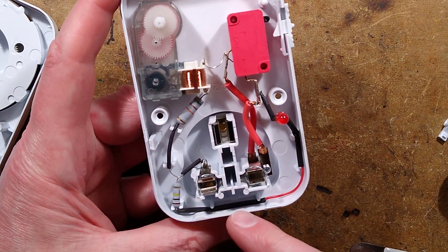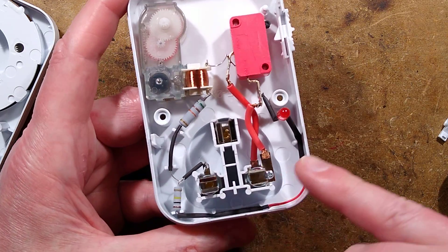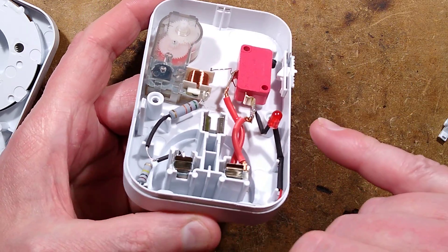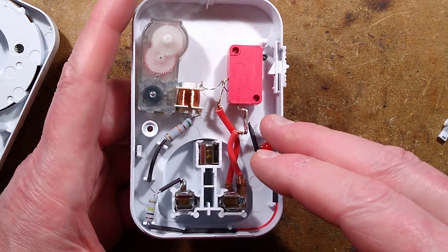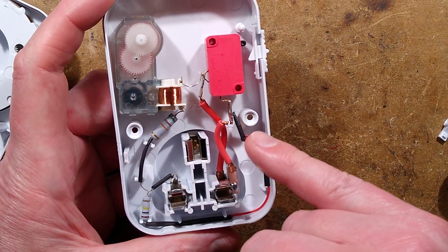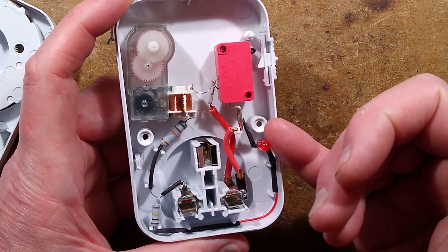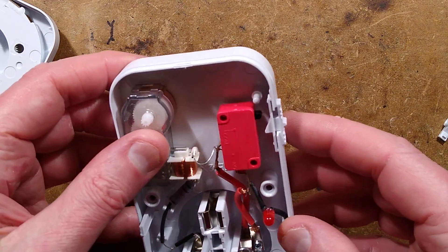There's also a 100k resistor in series with the LED. They're using a very crude circuit here in the sense that the LED is probably lit in one direction, but then it's just basically shunted out in the other direction, because LEDs have a sort of avalanche effect when you do that. You can only do it with traditional red LEDs — not the modern gallium nitride ones.